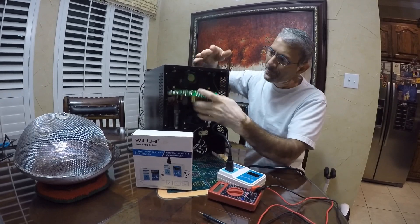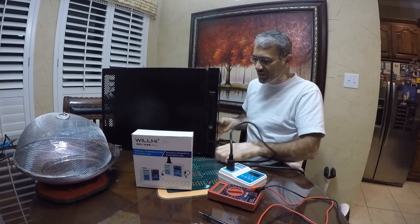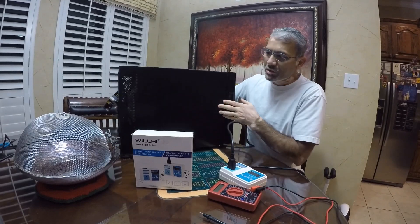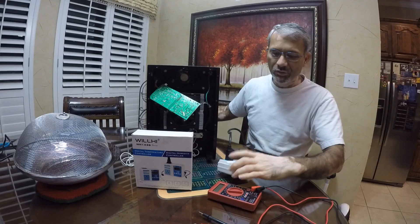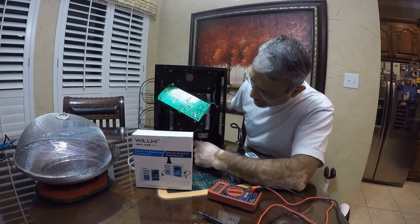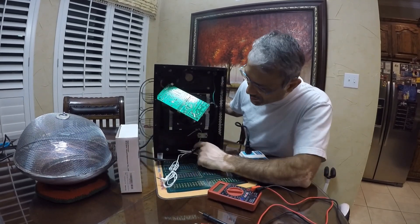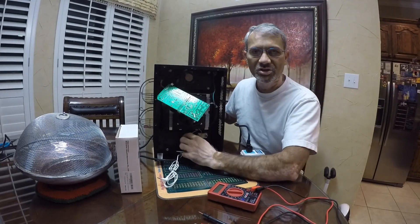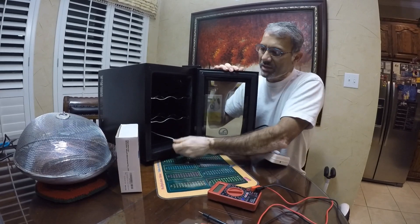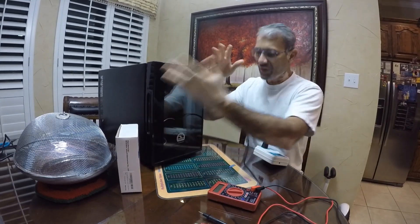That's all you have to do — just switch the connectors, black goes to red and red goes to black, and you're done. You've basically turned this fridge into a heater. Because it's a fridge, its control board is going to want to cool the inside, but ours will never cool anymore because we switched the connection. You want to put your own control board. It's easier to use something external than hacking the internal board. Drill a little hole in the back of the fridge and pass the temperature probe through into the body of the fridge, and just leave it hanging inside.